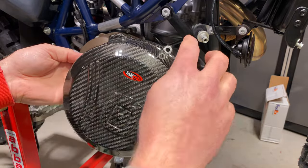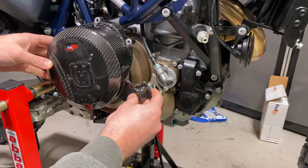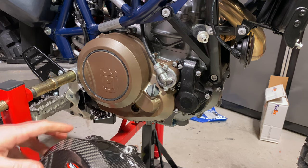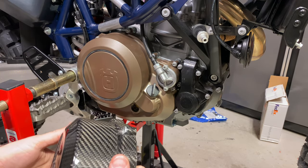You've got one, two, three holes here. This is right up front on the bottom so it fits right in there. The brake lever might become a fitment issue — we'll have to see. These are all T30s. You're gonna remove the two T30s here and the T30 around the back, and then it's done. Let's get started.